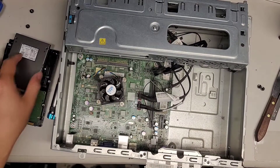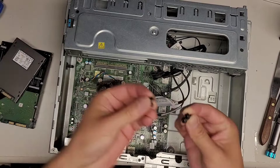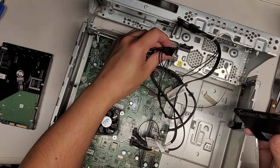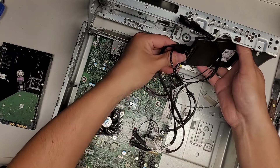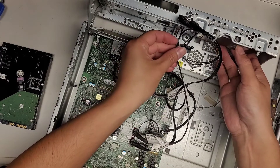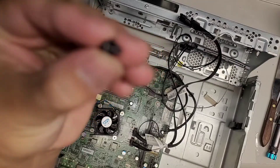The clone has completed, so we're going to now install the SSD into the hard drive slot. We're no longer going to need the four screws that were holding the hard drive in place, so we'll set those aside. Let's go ahead and lift this back up, and then reconnect the new SSD the same way.